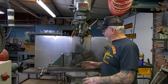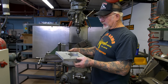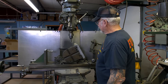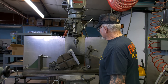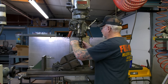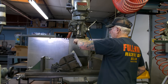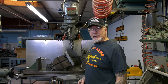This Bridgeport mill machine is specifically just to put double spark plugs in every Harley-Davidson head. I made all kinds of jigs to hold the heads. See, this jig would go right on here — then I'd center it on the opposite side of the head. So we're going to put a double spark plug in. This cuts away the fin, the aluminum. These are quick change attachments — I just put this tool in here, take the next tool, put it in. I could put a double spark plug in a head in less than six minutes, each head.